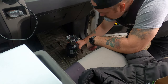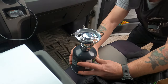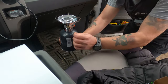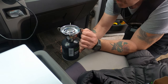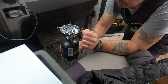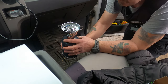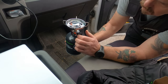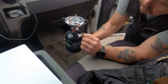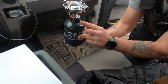You can see the flame going there — good. The trick with this is you've got to barely turn the gas on. If you put it on too much, the sparker won't light it. Barely turn it on, just a little bit of gas, light it, then turn it up. Left for more and right for less — there's a positive and negative on the knob.